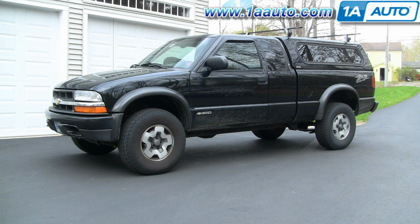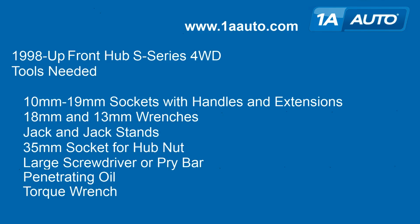Okay, this is kind of part two. We're going to install the front hub on this four-wheel drive S10, same as Blazer, Jimmy, and Sonoma. Tools you're going to need are metric sockets, 10 to 19 millimeter, plus some metric wrenches, jack and jack stands, a 35 millimeter socket for the hub nut, a large screwdriver or pry bar, penetrating oil, a torque wrench, and you might want to throw in a hammer and a rubber mallet too.